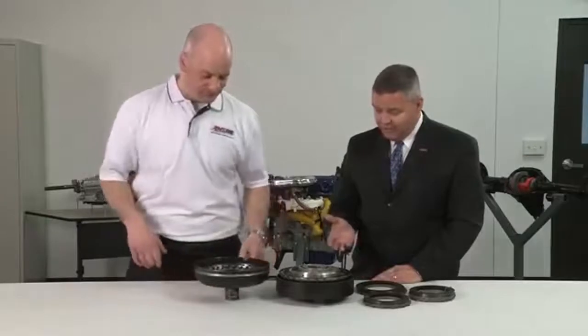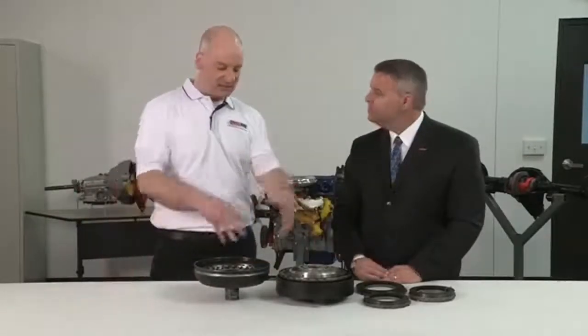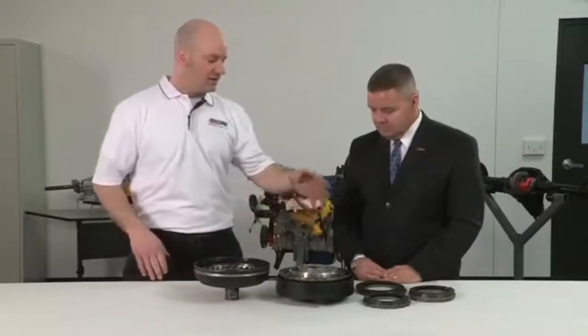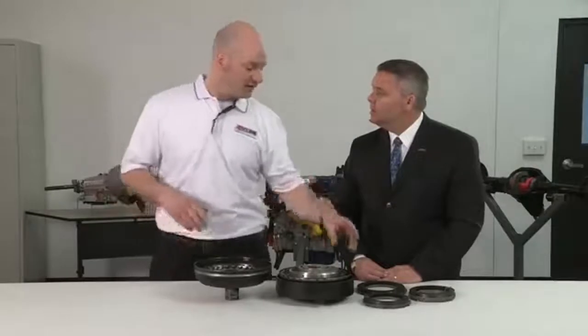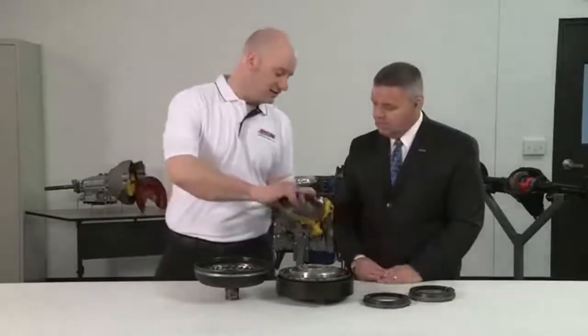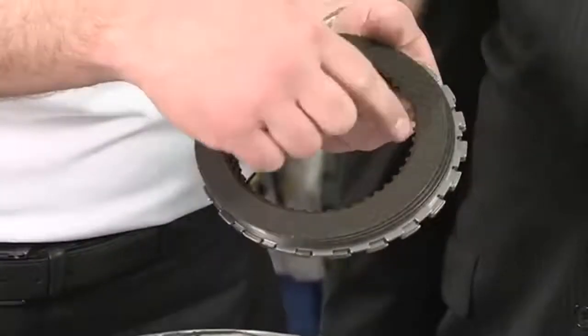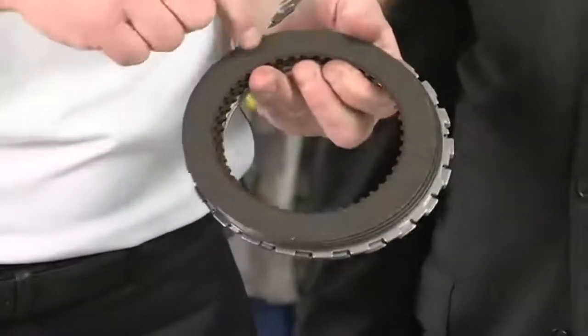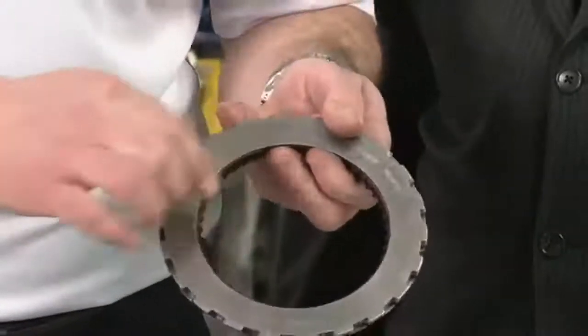And I'm not a transmission expert, but this equipment looks pretty clean to me. Scott actually had this stuff all analyzed. He had the converter opened up, as you can see here. He had the transmission builder open up the transmission internals. And what they found was that these clutches looked so good. Now, normally if the fluid would have failed, you would see black buildup. You would see all kinds of charred remains of clutches, and this clutch would have failed. You would see bluing on these discs.